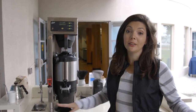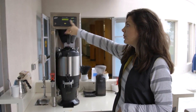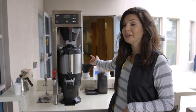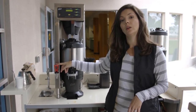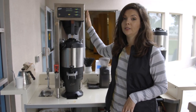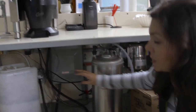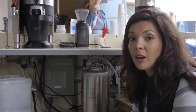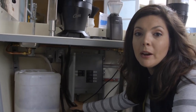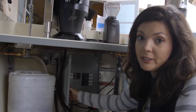Let's talk through how to power down, wrap up, and clean up the machine. The first thing you want to do is turn off the brewer — both on the front and then by flipping the switch on the back. Once it's turned off, empty all the water stored in the heating tank by using the hot water valve. Get all the water out and get the machine totally powered down. Then come down here, unplug everything we plugged in at the beginning, and turn all the valves to off — all the valves we turned to on, we're turning back the other way. When powering everything down after unplugging, don't forget to flip all the breakers to off.